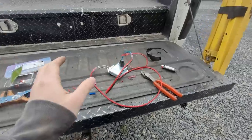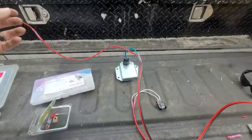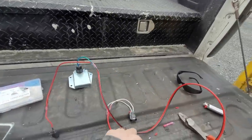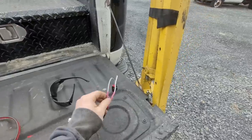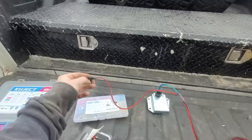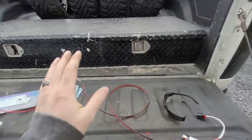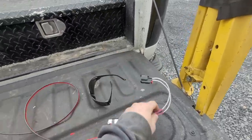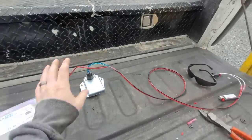For the small stuff we have these really nice ones right here. Here's what we've come up with — you can see everything's all nice and sealed. This will go into the fuse box. It would be nice to have the vehicle in front of me to build this out, but I have mine for reference so I know how long to make everything. Worst case, I put the positive to the non-black line and the negative to the black line. We'll find which one is key-on power when we get there. We'll put our two fuses in, run this along the radiator in the front, plug this in, and if wired correctly we will have charging. If these are backwards, all we'll have to do is flip them the other way. So we're going to loom all of this, make it look good, get it all zip-tied up, and make this look like a factory harness.